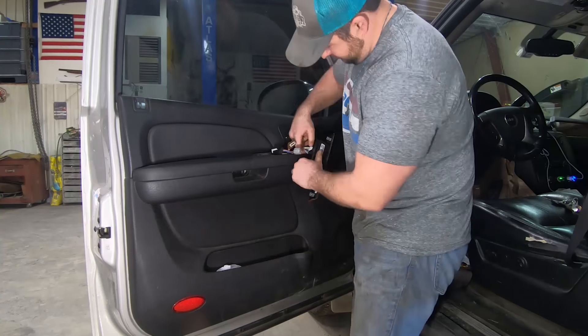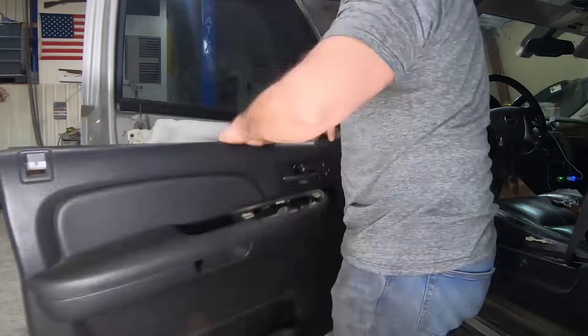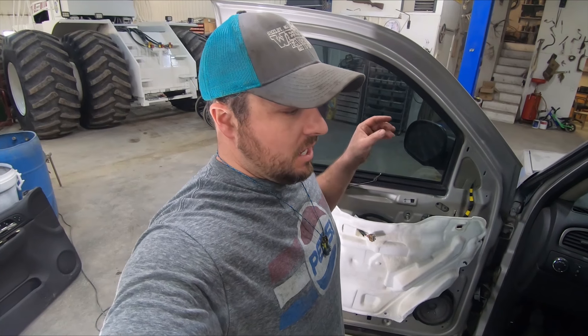There we have it — found the problem. Actually, there are quite a few wires in there that don't look very healthy. I've got to pull the door panel off and fish the wires through so I can get some movement and work on them. The heated seats weren't working either, and I believe all the wires that are broken are the reason for that. The reason the wires are broken is we have really cold winters up here, and with rubber — it gets cold, it cracks. Every time you open your door, it's freezing, it cracks and then it starts breaking the wires, and that's what happened.